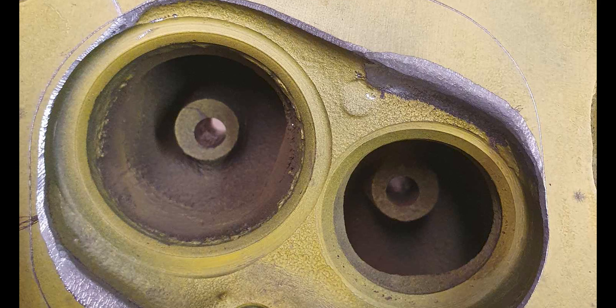After the carbide burr work is done, Craig will then spend the time needed to smooth everything that's been cut with the chamfer using a stone, so it's all really smooth — along with the rest of the combustion chamber inside. This is similar to what I did in my first video where I smooth all the castings, lips, and machine surfaces when the valve seats are put in. Just keep in mind that all of this is normally smoothed with a stone after all the basic cutting and de-shrouding is finished with a carbide burr.